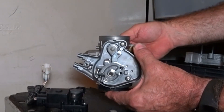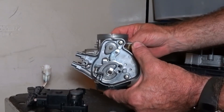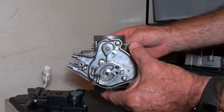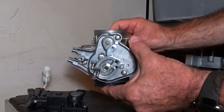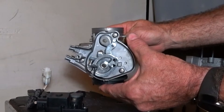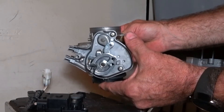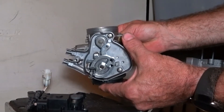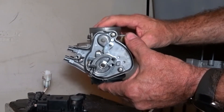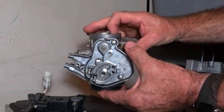What happens in the hanging idle situation is, for whatever reason — and it was never fully located or rectified by Husqvarna or BMW back when the bikes were new — on some problem bikes, you're riding along the road merrily, everything's normal, you close the throttle, the system drives the throttle open to reduce engine braking, and built into the software is a decay period where it should close over time and return to a regular idle. For whatever reason, some bikes maintain that high idle condition. The throttle's not stuck as such; it just can't return because of this cam here.